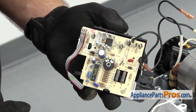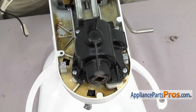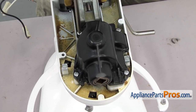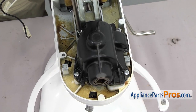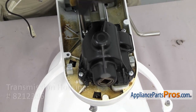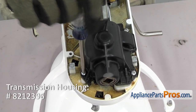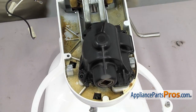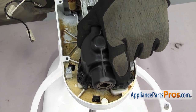Once you have all the wires off, you can pull the speed control board off the mixer. Now that we have the speed control off, we have to take off the housing for the gear case, which you can use a Phillips screwdriver to take out the screws. Anytime you're in here working, if you have this old style plastic housing, the manufacturer recommends that you upgrade it to the new metal one because the plastic one has a tendency to crack. Once you have all the screws out, you can lift the housing up and set it aside.